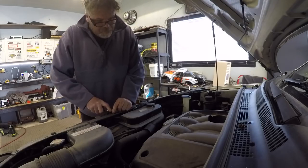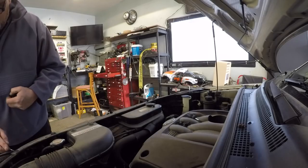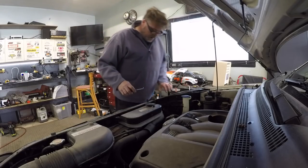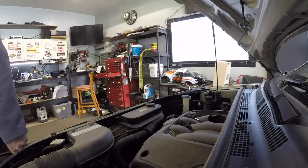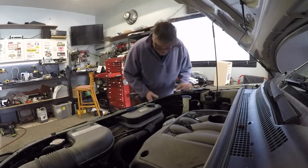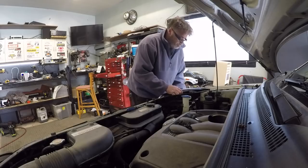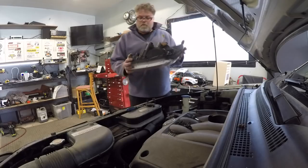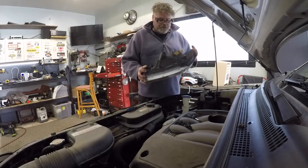Look at that — we got a sticky wicket. There it is, there's the little doodad you lift up, pull the little pin on there, pull this side off. And then the headlight should just fall right out. There she is — easy, careful, gentle. So there's the headlight. I just pulled that right out of the thing. Let's snap that back in — snap-a-rooski. We'll get this headlight out of here.